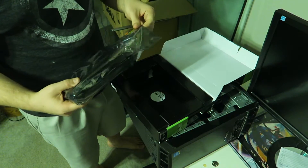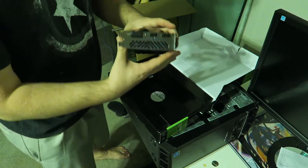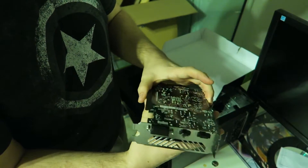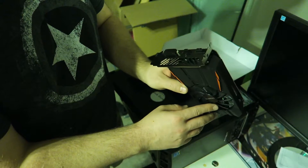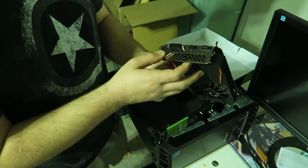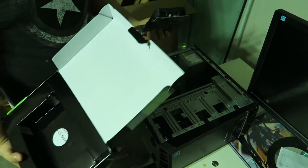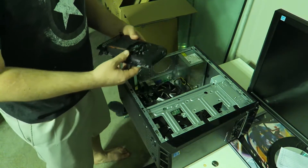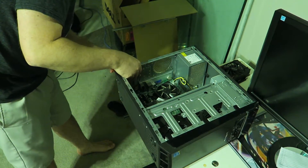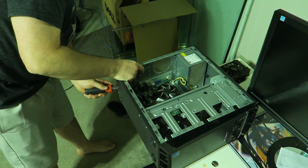Take the card out of the anti-static bag. It's about a one-and-a-half slot cooler design. You've got your DVI port, HDMI, and DisplayPort, plus a long cover and your PCI cover on the bottom with a standard fan. On this system we had an extra PCI cover to take out — just needed a screwdriver to shove into the slot and wiggle it around and it popped right out. Nothing too difficult; I don't suspect anyone will have much trouble doing this.